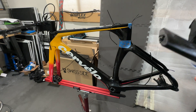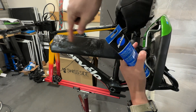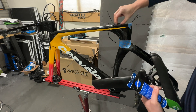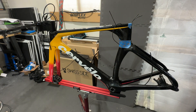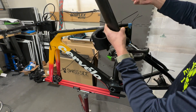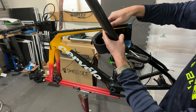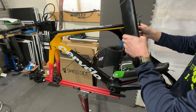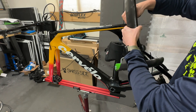One thing I've done is to reapply some carbon paste — I'm using the Park Tool SAC2 — just applying a fresh layer of it before I reinsert it into the seat tube. I'm going to remove the bracket that locks in the seat tube. Now I'm going to connect the wires one by one into the battery. I'll start with this one — this is the wire coming in from the front. Then I forgot which is the front or rear derailleur, but these are the derailleur wires.